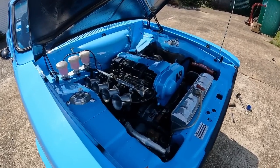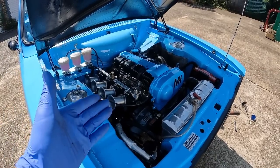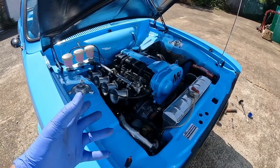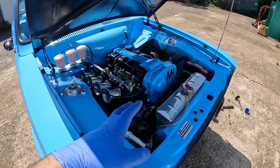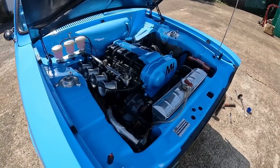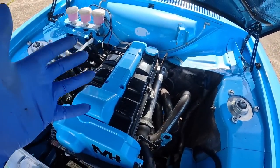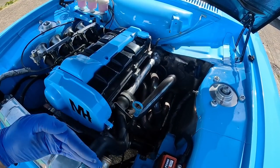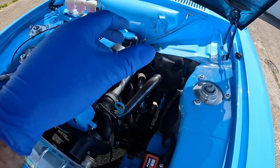If you've been watching my videos any length of time, you'll know that this car isn't the easiest to work on, especially when it comes to getting into her bell housing to inspect the clutch, etc. Usually, you would take the gearbox off the back of the engine with the engine in situ, or some people will lower the whole lot down. But the way I like to do it is basically disconnect a load of stuff, then hoist the engine up, remove the bell housing bolts, pull the engine forwards, and leave the gearbox in situ — and then I'm able to get to the clutch.